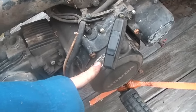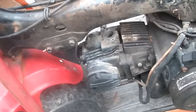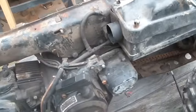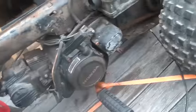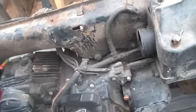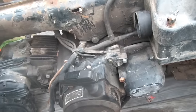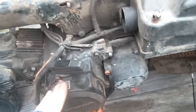Since putting the recoil on, I did a compression test and it came in at about 110 to 115. Now that it's all bolted together, I'm going to filter out that oil and put it back in. I just want to get it fired up with some oil in the crankcase — I don't want to dump another quart into it, so I'll filter that oil and put it back in the cases.